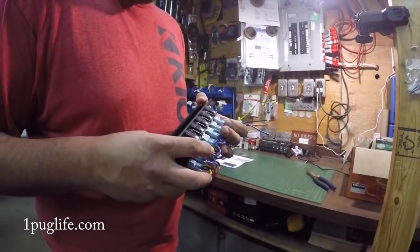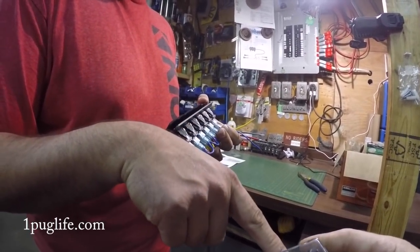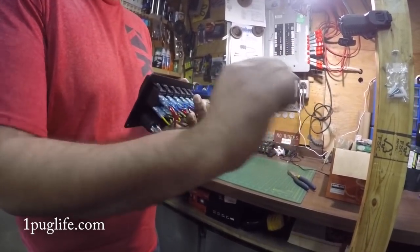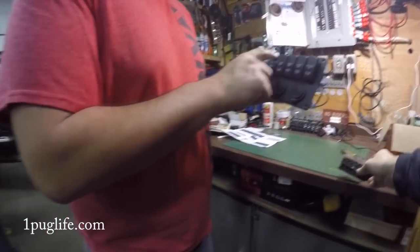It's just an inline jobby, right? Well, you want one to be a switch power, one to be a constant power. The switch power is going to trigger the relays when the engine comes on, or when you turn the switch on, and then these will all be on ignition power.